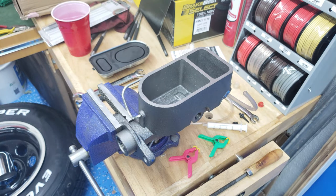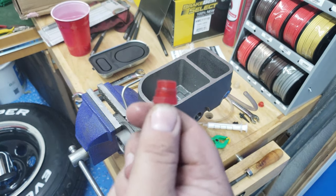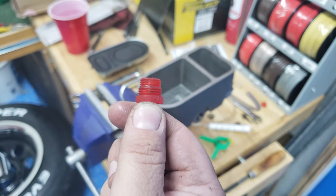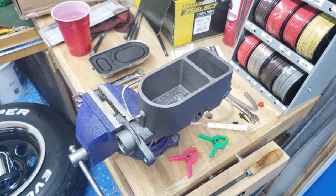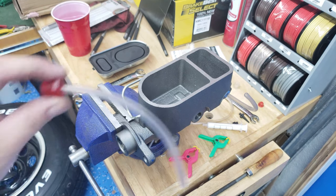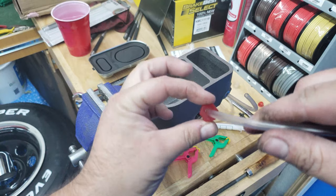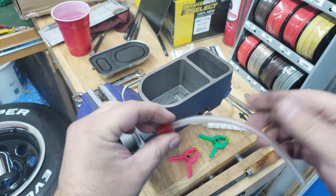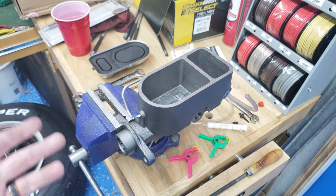What it came with was a couple of plugs, right? Just like this. Nothing to it, just a plug that I guess you could kind of use to bleed it. But I don't want to do that. I want to actually try to bleed it the right way. So I modified the plug by adding a hose to it. I just drilled a hole through and stuck a hose in there. I had some clear hose from another brake bleeding kit that I had. And that's going to work perfect for me